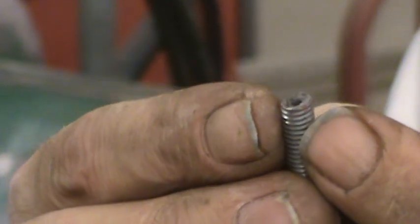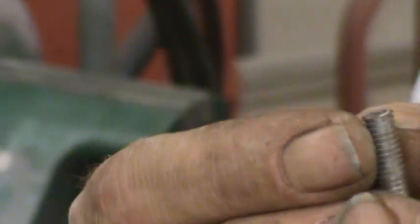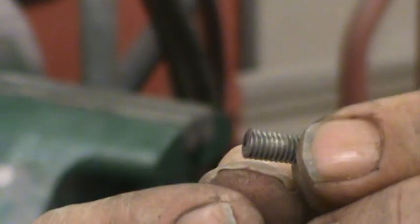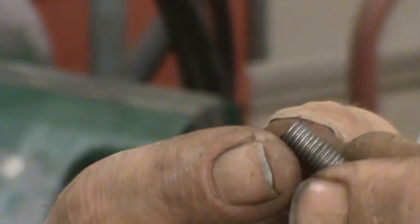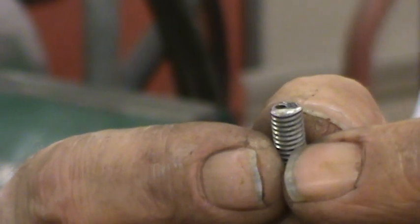Anyway, I'm going to tune some more on this a little bit, and I think I'm going to go ahead and stick it in there and just hook it up, and when JB Weld sets up I think it'll be just fine. So I'm going to grind some of this down right here and make this end nice so that the hose will slip over it pretty easy.